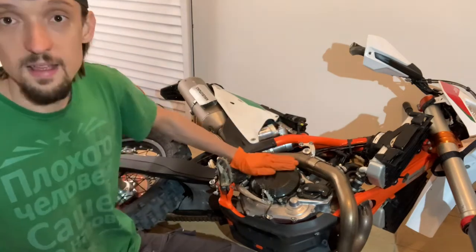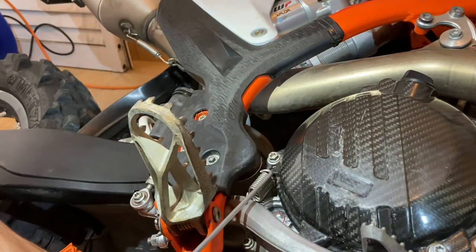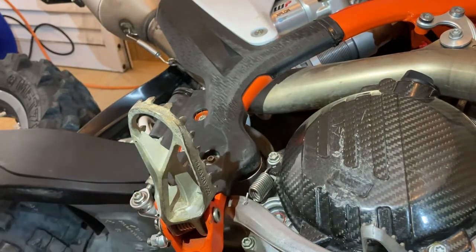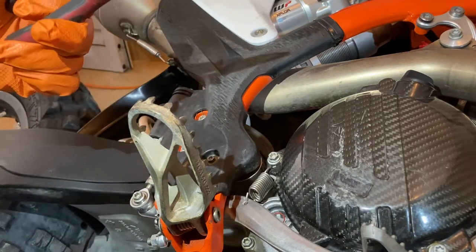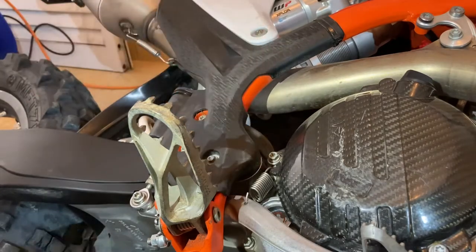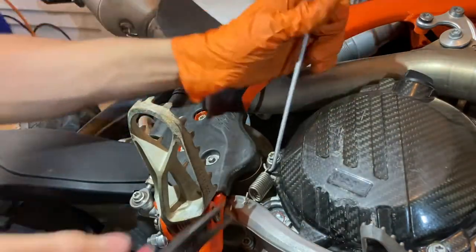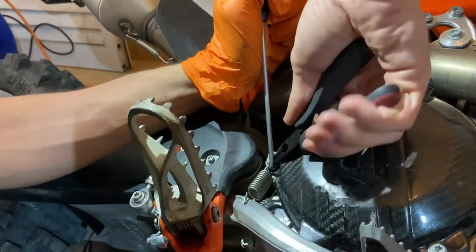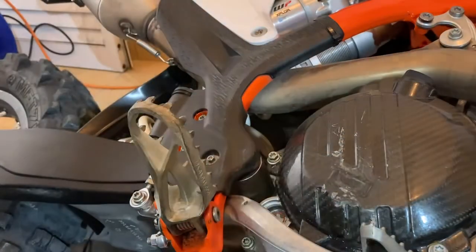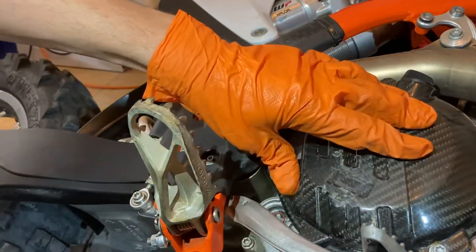The first thing we're going to do is undo this spring hook. Lo and behold, special tool time — this is a spring hook tool. It's not really going to happen with just a pair of needle nose pliers; it will, but it'll take more time and you'll scratch up the engine cover. With this tool it's pretty simple — grab onto it and use the needle nose pliers to pull it out because it's curved. Remove that so you don't lose it, and then we're going to take off the protection cover and the clutch cover.